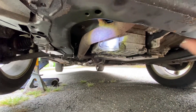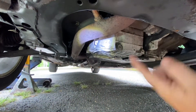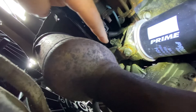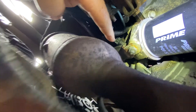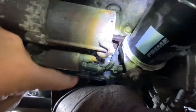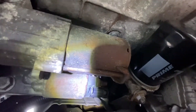This is the front of the car, and we're looking at the passenger side. You can see the oil filter — the sensor is on top of the oil filter housing. This plug right here is kind of hard to get because the starter is in the way. The starter only has two bolts — one here and one here, I believe those are 13s — and you can just hang it out of the way to get to that plug.